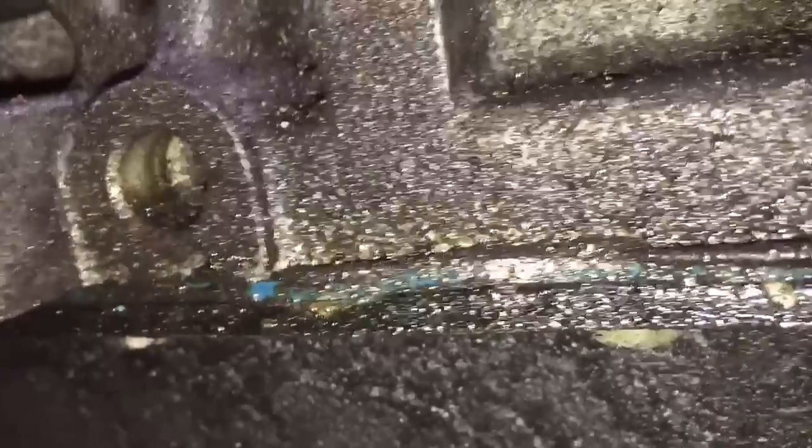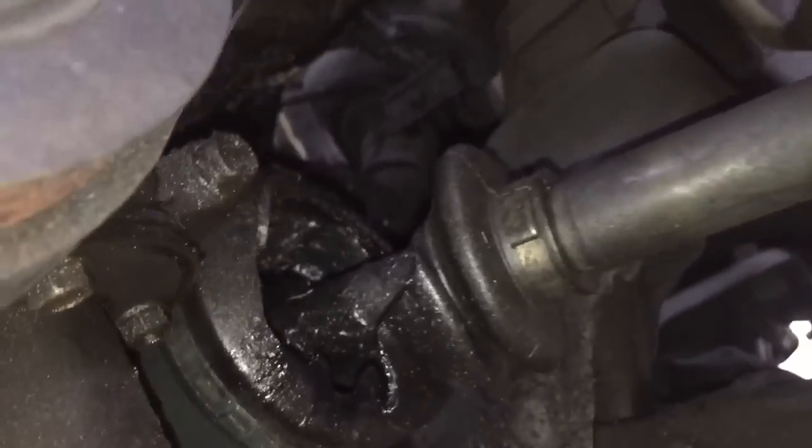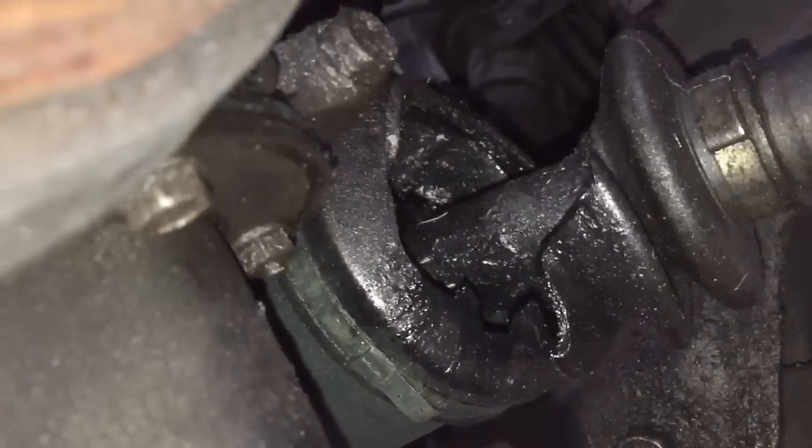Okay guys, coming from the front bumper down to my friend, the oil pan. There's a bolt right here I'm gonna take off. There's some oil right there — let's see where that's coming from. Looks like we need a new oil pan gasket; it's leaking right there. We're gonna have to get that soon. Also the axle boot — that's just shot, so we're gonna get that too.